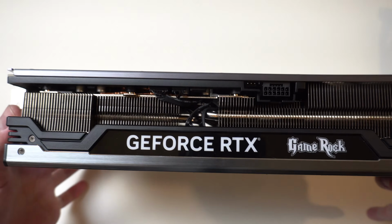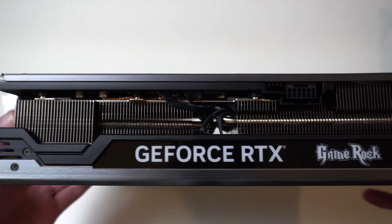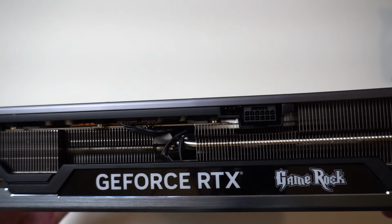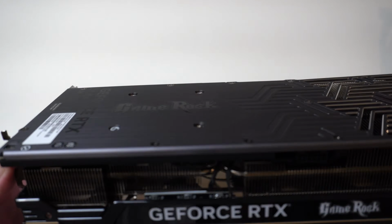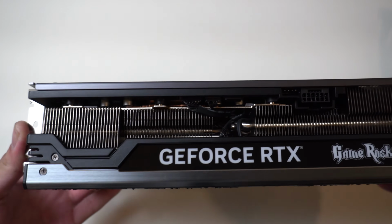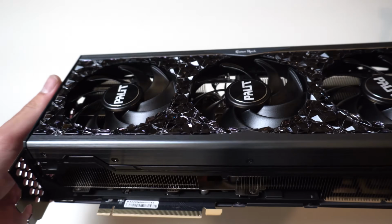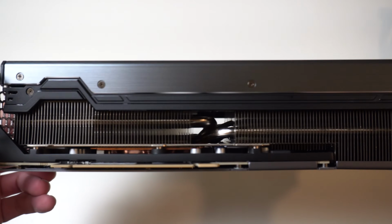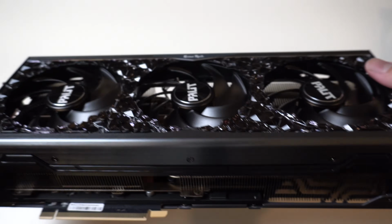And because of that, as you can see, it also has intricate engineering put into the card itself, which I hope will translate into actual performance once we test out the card. I mean, the card itself is just a heatsink the whole way through with lots of heat pipes, as you can see under the fan there. Yeah, they have 6 and 8mm heat pipes apparently on top of a vapor chamber that spreads the heat from the GPU and the memory chips itself.